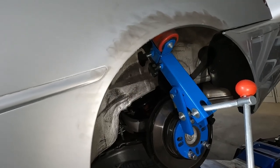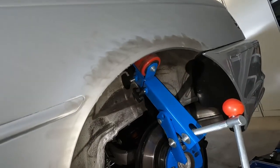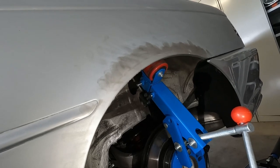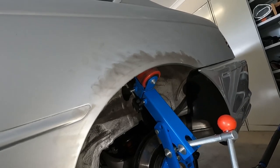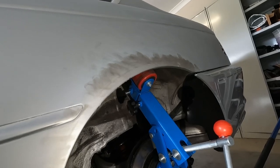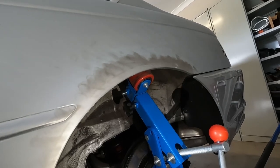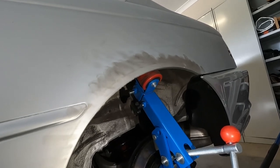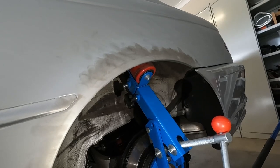Use a hairdryer or a heat gun or something along those lines, because you don't want to crack your paint. This side, my paint's already cracked and I'm about to go and paint it, so I don't really care. I'm going to do it and try to preserve it as much as I can. But the paint's probably all going to crack and come off, and I'm going to sand it back to metal and prime it up. You win some, you lose some. For yourselves, definitely, definitely use a heat gun or a hairdryer and heat it up nicely to get that paint nice and soft to try and not chip it.